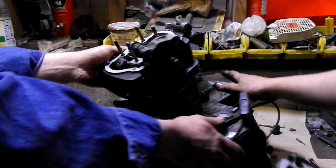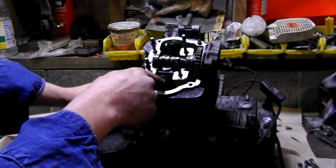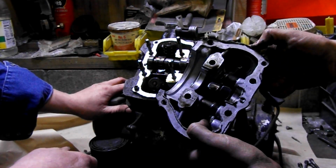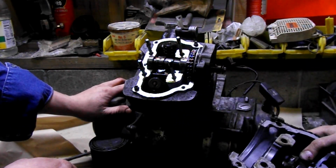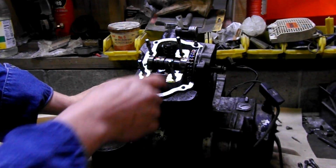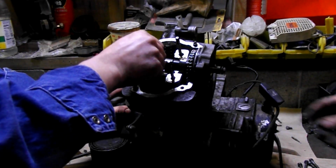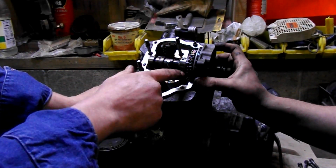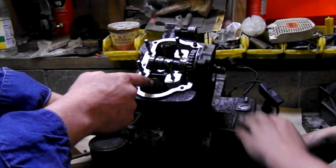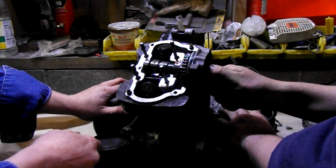And in here you'll see you've got your camshaft, which pushes lobes and operates these things. As seen here, you've got actual rockers. They're pretty easy to access. You can make little shadow puppet shows if you wanted to. But basically, the gist of it, if you've never done something like this, is that your crankshaft is on the other end of this chain, which spins this. So as the engine turns, it operates the valves and feeds itself. Like a fat chick, it just keeps feeding itself.